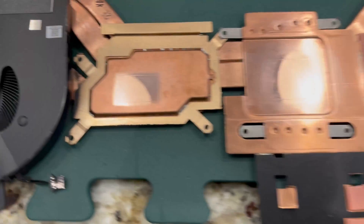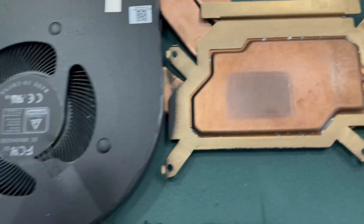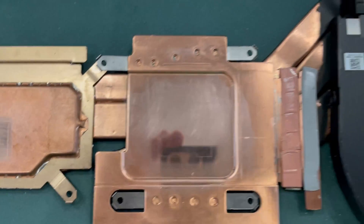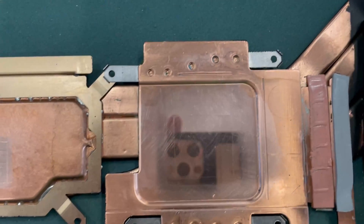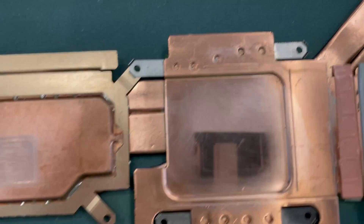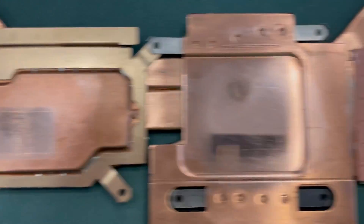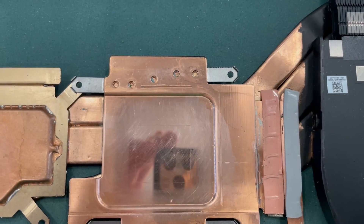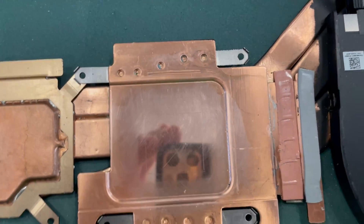On the other side, something I'm doing differently is I plan on nickel plating the copper. I don't think the shine actually makes a difference — I did some buffing to shine it up, but copper is so soft that even after I shine it up, cleaning it with a good scrubbing of alcohol puts the scratches right back in, even using a soft cloth. I found that interesting — copper is a really soft metal. It's hard to get shiny and have it stay shiny. So just cleaning up the sections that I will be attempting to nickel plate.